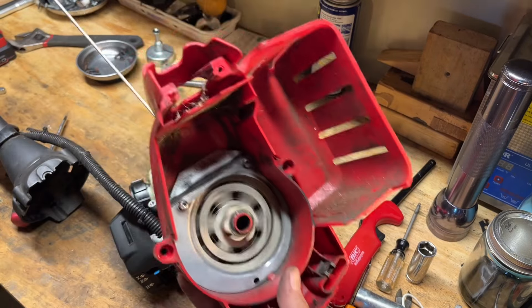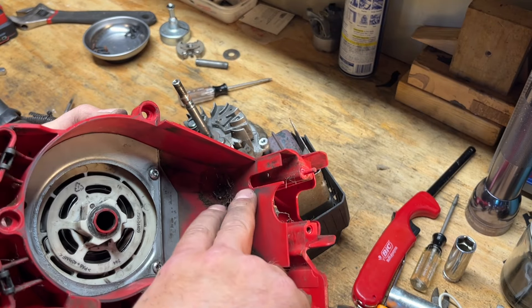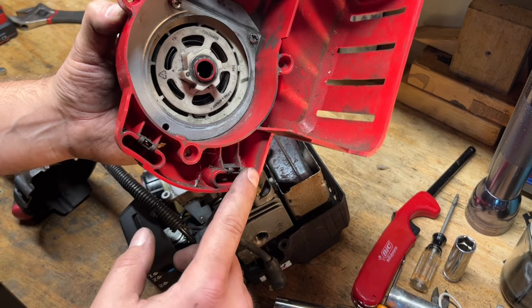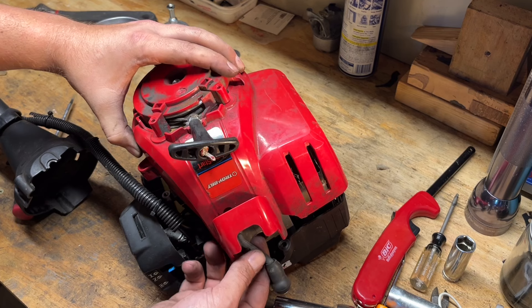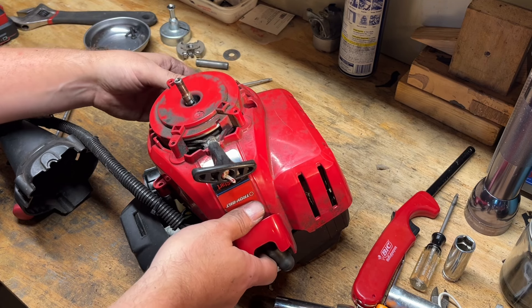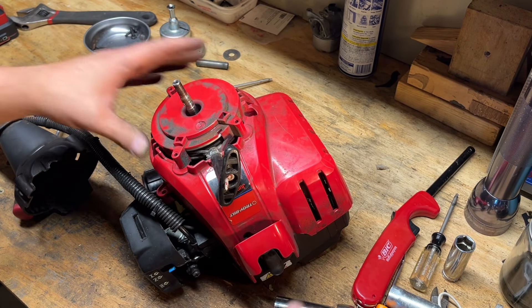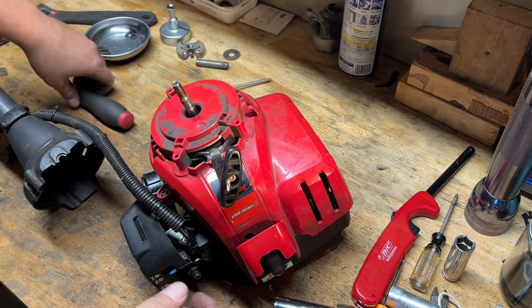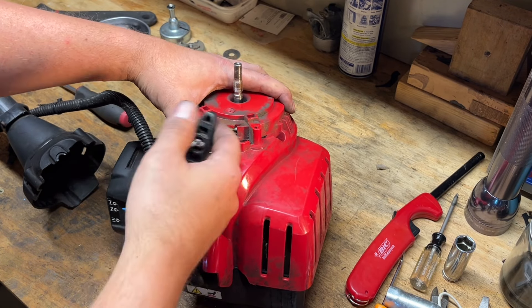I think I got it good enough. I don't know if it's ever going to be perfectly straight, but let's get this dropped in here. The bottom actually needs to go in that little slot instead of on top like that. Back on the engine — double check, no noise there. Here's that slot that the spark plug wire needs to slide into, and the gas tank needs to slide into these slots as well, keeping the kill wires in that slot too — so a lot of things need to happen at the same time. Try it one more time, hoping for no noise. Yeah, I think we're good there.